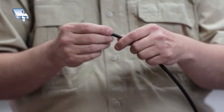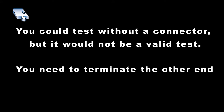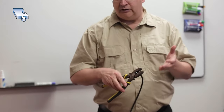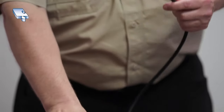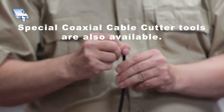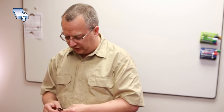I've put the end on the cable and now I need to test it. To test a cable I need to put a second end on it, and I'm going to put the other style of end on so we've got both styles. I'm cutting the cable again — this time using lineman pliers. That did flatten the end quite a bit, so I'll squish and round it out again with my finger or the tool.